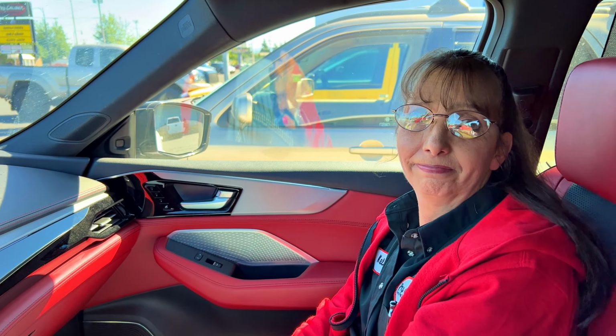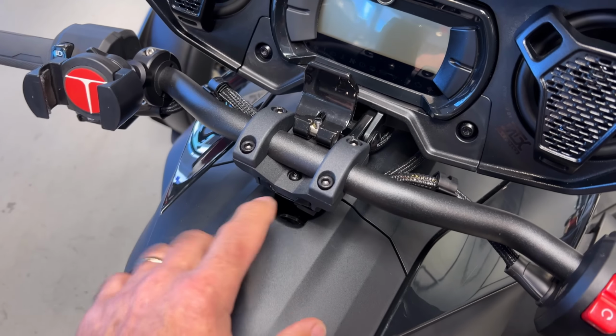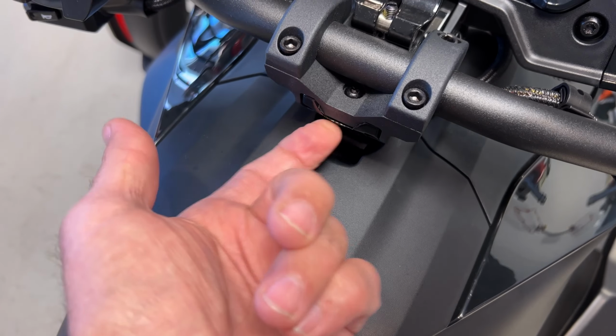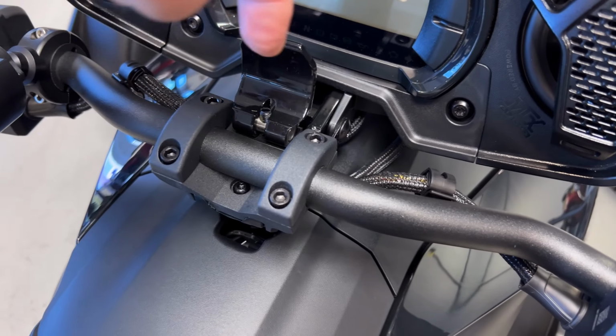Bye-bye now. So yesterday I was telling you guys about adjusting the handlebars, how they don't come back any further. Actually, it's quite easy. You just loosen the handlebars, set them aside safely, and you take that screw out right there. That's a limiter that's keeping it from coming off. So I'll be able to set this back and get that out. But I'll show you what happened to the tool here. Gotta stay away from that fan.